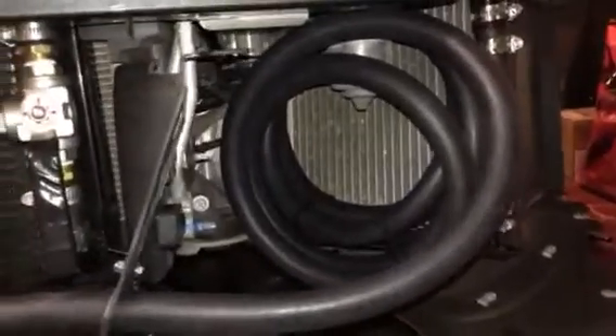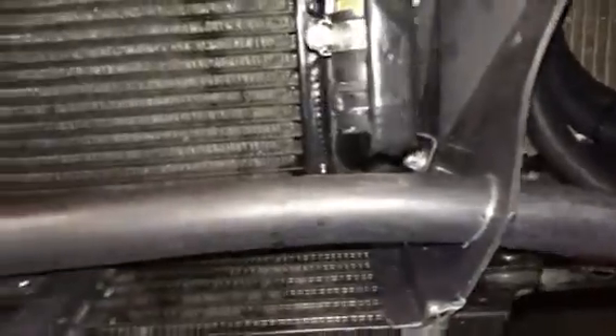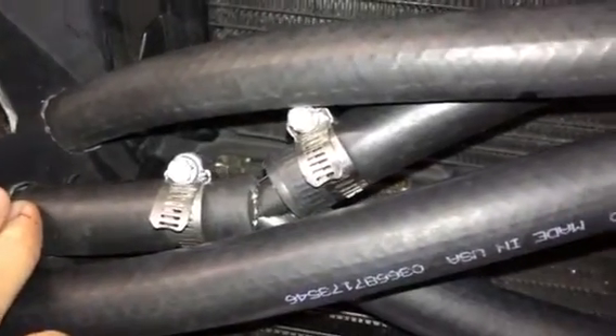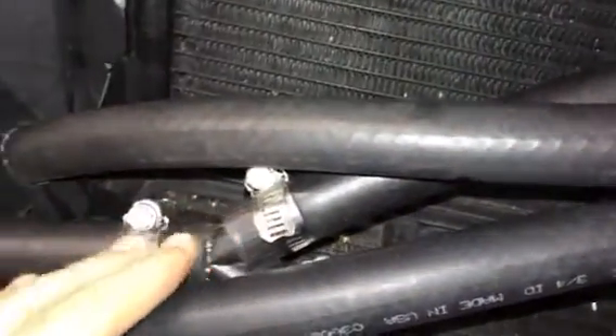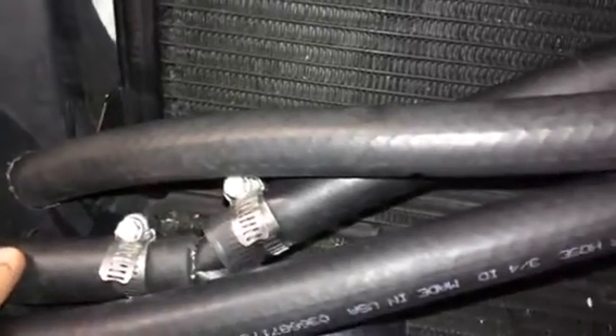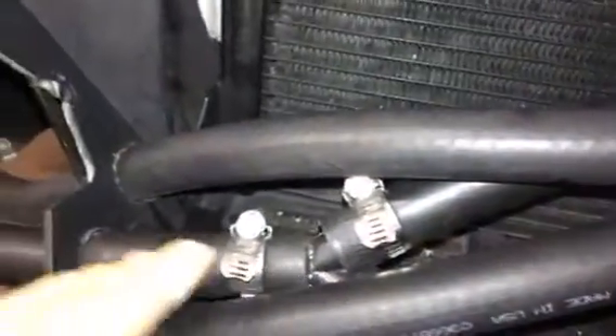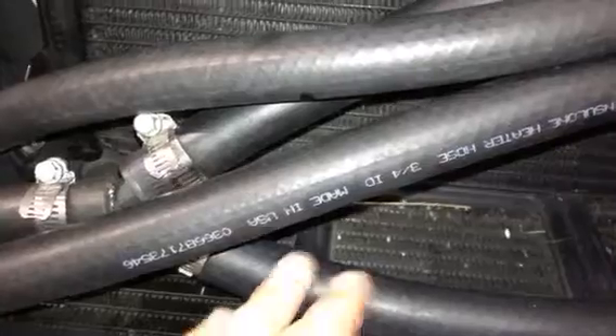From the factory right here you have two black plastic pieces that come out. I've got 11 feet of three-quarter hose coiled up there, zip-tied back, then it goes through here to a three-way joiner. When it's bypassed, the cold fluid goes through here in this direction into the Killer Chiller. If you're running through the traditional Edelbrock front-mount heat exchanger, the fluid comes out the top of the heat exchanger, comes down here, and goes this direction. When bypassed, the fluid in the heat exchanger side is stationary; vice versa when going through the heat exchanger.